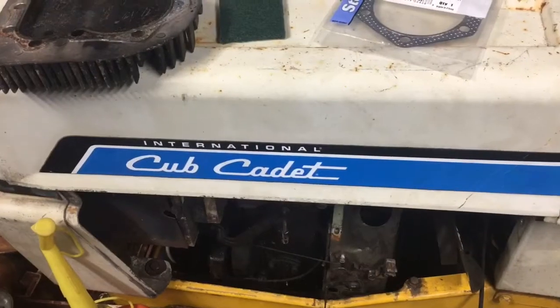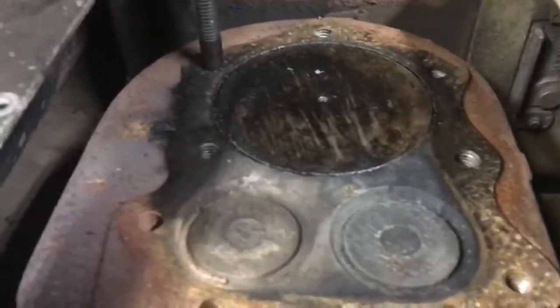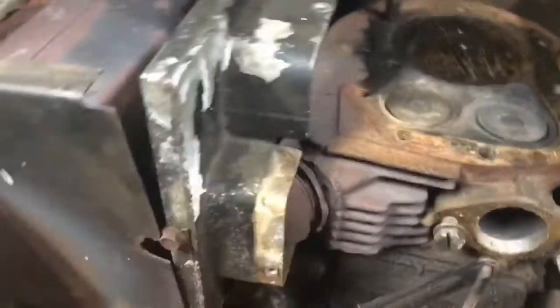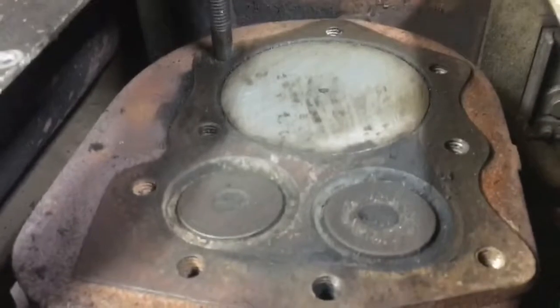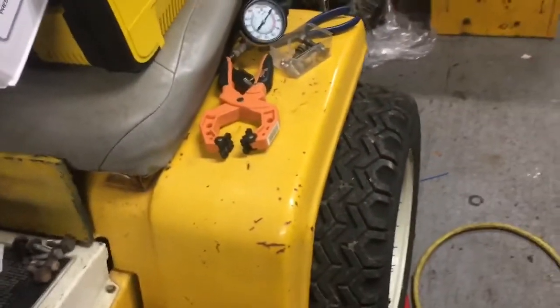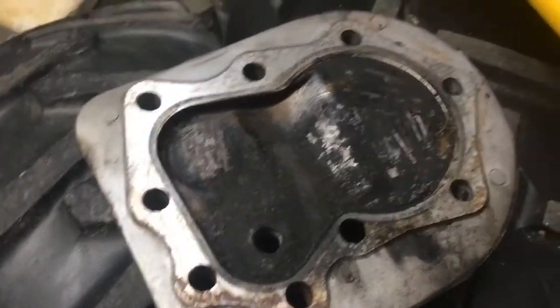What you're going to want to do is clean up the surface where the head gasket is going to go. You want to make it nice and clean so the head gasket has a nice spot to mount to. The top of the block is clean now. Also clean the piston — that's a good idea, make sure you get all that soot off. Now I've got to do the head, so I'm going to grab another piece of Brillo pad. I was that dirty. The surface is most important — scrub that for a while.